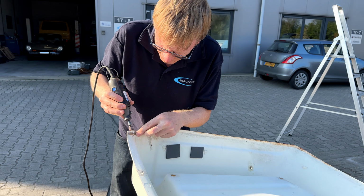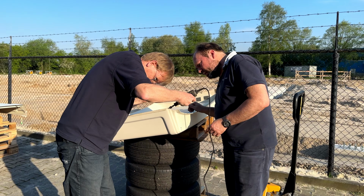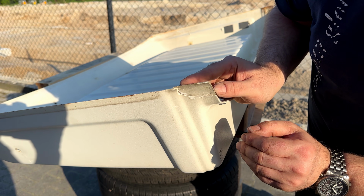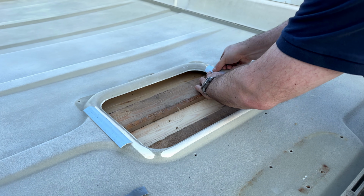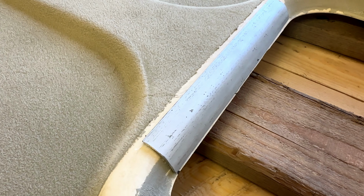While we were cleaning the last bits of silicone tape from the van, Wim and Ian started on repairing the roof with glass fiber. In order to support the big crack on the roof, we also made some aluminum strips to support the cracks that we would fill up with epoxy later, in the hopes that they wouldn't crack again.